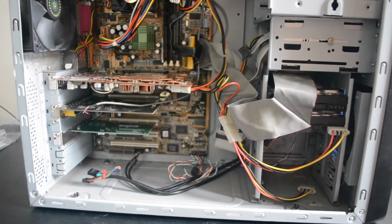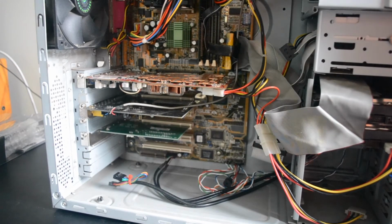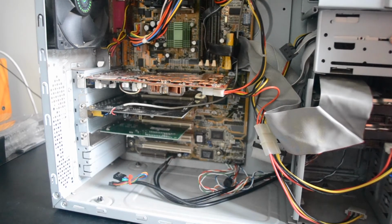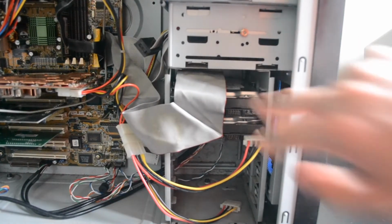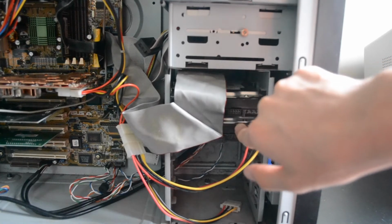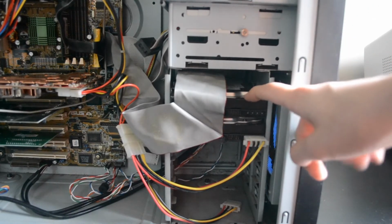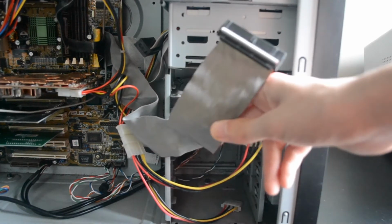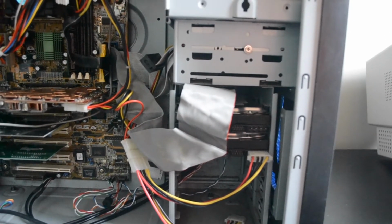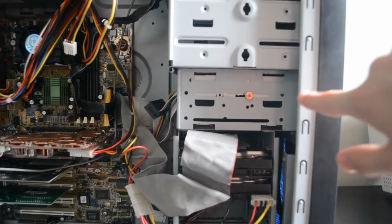Definitely love the ATI. Moving down to look at some more cards, we have a sound card, which is a Sound Blaster Live, I believe. It's a PCI card. And below that is just a generic, I believe it's a D-Link networking card. Over to the right here, 2 hard disks, I believe. The main one, which has the system volume, is an 80 gigabyte Western Digital. Western Digital is my favorite hard drive brand, and above that is a 20 gigabyte Western Digital. Not sure what that's for. In fact, I think it's disconnected. Okay, that's just lovely. Anyway, up at the top I have 2 DVD-ROM drives. Not sure the speeds on them, and a 3.5-inch floppy disk drive.